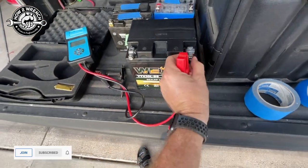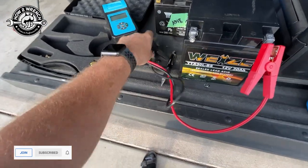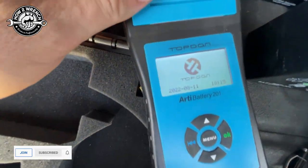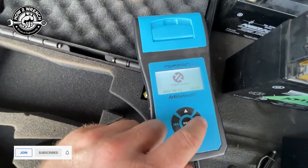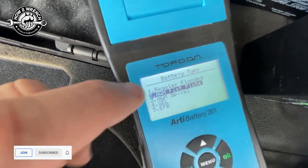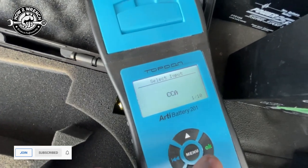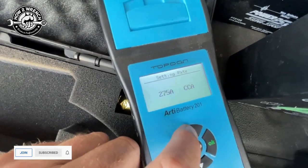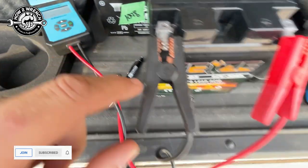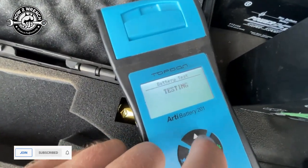You can see these connections are loose, and this is what I think may have been my problem. I'm going to go ahead and grab onto that. I'll just put it on here — you'll see this fires up. I'm going to go ahead and hit OK. Battery test. It's an AGM. I still don't know the difference of those two AGM options, but I get the same exact results from doing a million of these. Cold cranking amps — I lowered it thinking, let's see what happens, so let's go back up. I'm pretty sure this was a 310 cold cranking amp battery. Unfortunately it's not labeled on here, I'd have to go look at the sales ad. But go ahead and test.